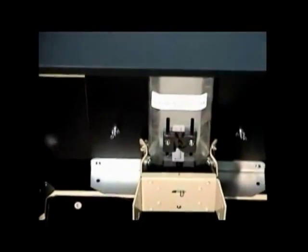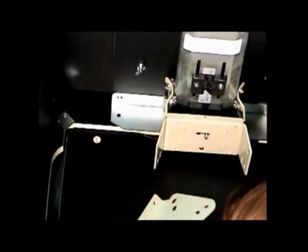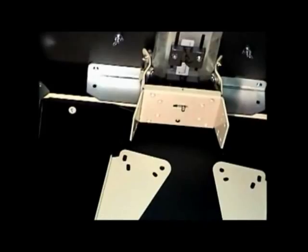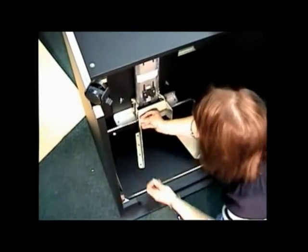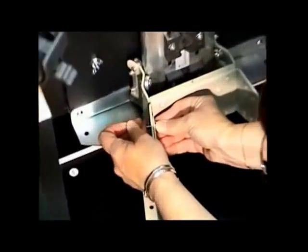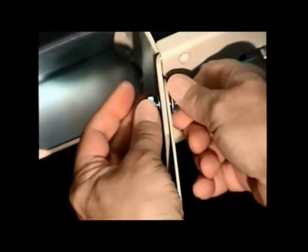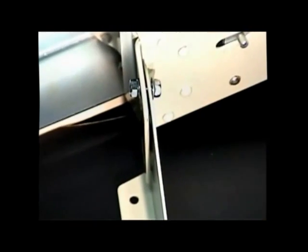The metal wings are installed to the inside of the airlift with the flange to the outside. Each bolt, washer and nut is to be installed very, very loosely because we will tighten them later.